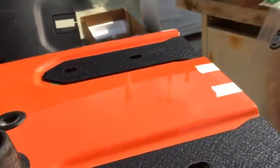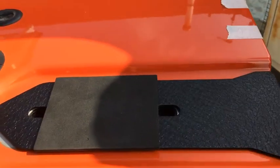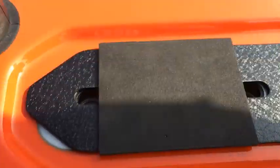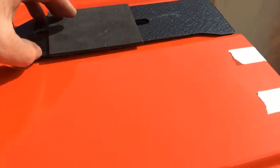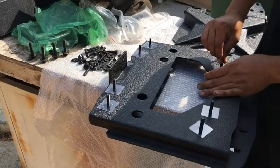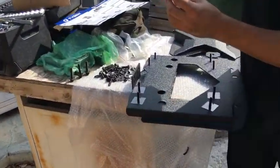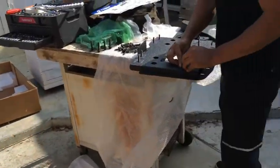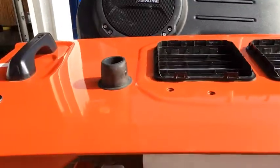Put these cover plates on and the foam is gonna fit on there like that. We decided we're not cutting anything, we're just gonna even it out and run with it. This one already comes with factory foam — even though the instructions say to install it, it's already got foam. But I guess we're supposed to run double foam, so that's what I'm gonna do. Put this onto the cover plate, get the four bolts — button head washers and flat washers — put it on and snag it up. It says don't torque it — just snag it up — because you still need to do a final torque and alignment.